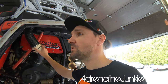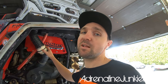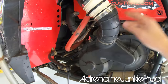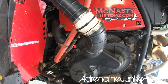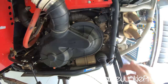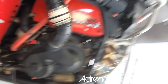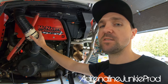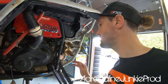Mike says with the primary fan cover I probably won't need the inline blower. Testing showed it doesn't add cooling at higher speeds, though it does help bring more air through the CVT at lower speeds. I'm going to try locating an OEM pipe to replace it and do my own testing using the Razerback Technology infrared belt temperature sensor I have installed, so I can compare results with and without the fan.